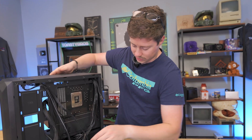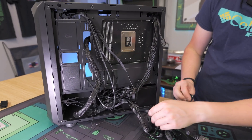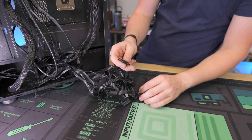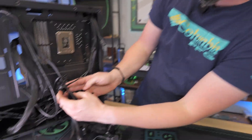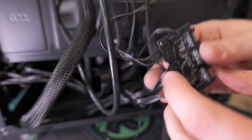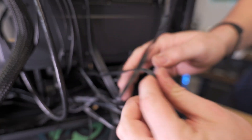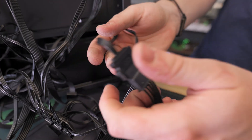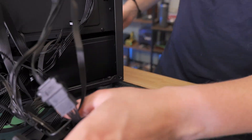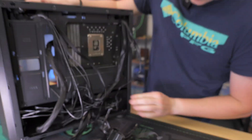At this point we just have one more thing to plug in. Sometimes on custom builds we'll use Molex connectors to power fans and SATA connectors — this case is a lot more simple. It just has this tiny hub for the fans, and you just need to find the power — it's even labeled; I see 'plus 12 volt.' There are our little SATA connectors — you just plug it in like that. They should only go in one way. I promise you'll see some smoke if you force it, so you don't want to do that. Go ahead and stick that back to the power supply.